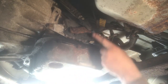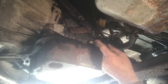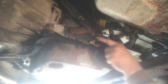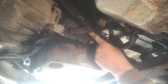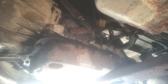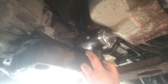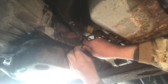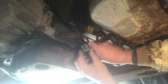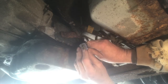The wiring harness for the selector switch has two connectors. These connectors are glued in, so you want to heat them up before you try to pull them out. That's what we're going to do right now. There, that did it — you can see the glue in there. It is glued together.